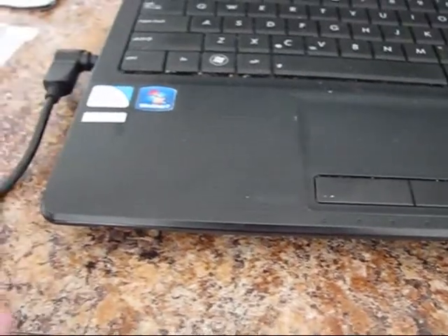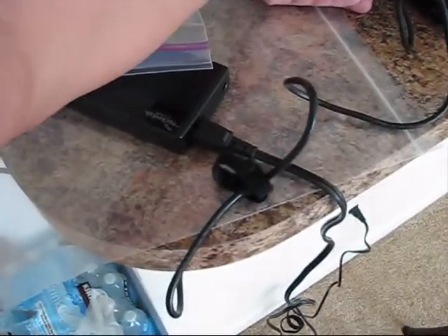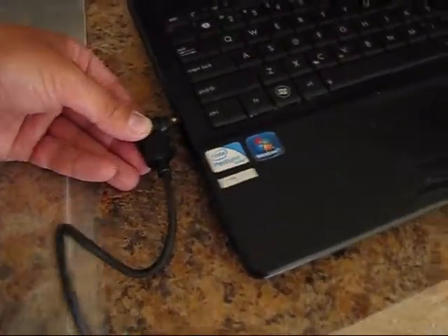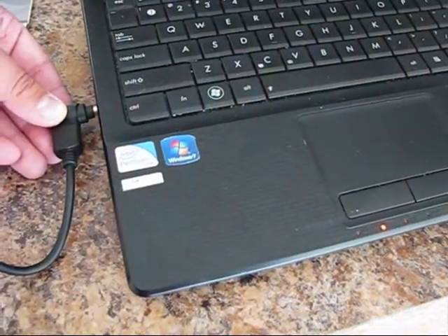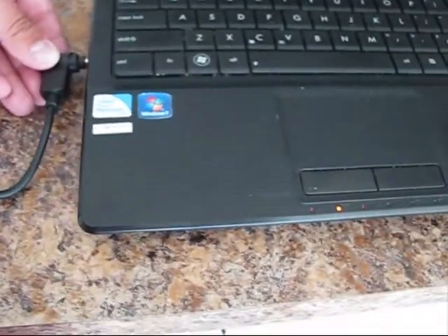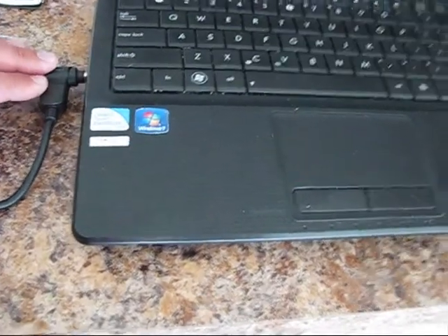Alright. As soon as it was plugged in, we can see that current starts circulating. Let's turn it on. From this, I found out that it's not a power adapter issue — it's the power jack, which is loose on the motherboard itself. When I'm pulling down just a little bit and holding it, I can see the battery indicator is on. As soon as I release the tip, the indicator light is gone.